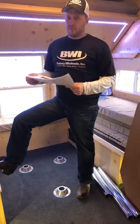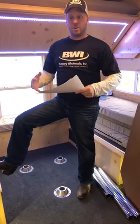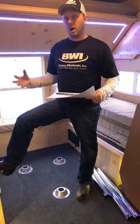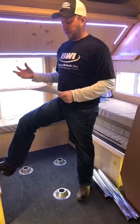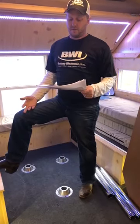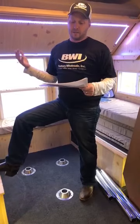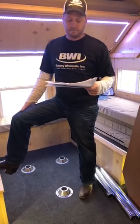The other thing, if you want to get more amp hours, is to move up in size. You need more cubic inches to get more power, is really how you have to look at the battery side of it. The Interstate SRM29 has 126 amp hour, the Exide 31DC is 115, the Optima 31DM is 75, and the Northstar AGM has 103.